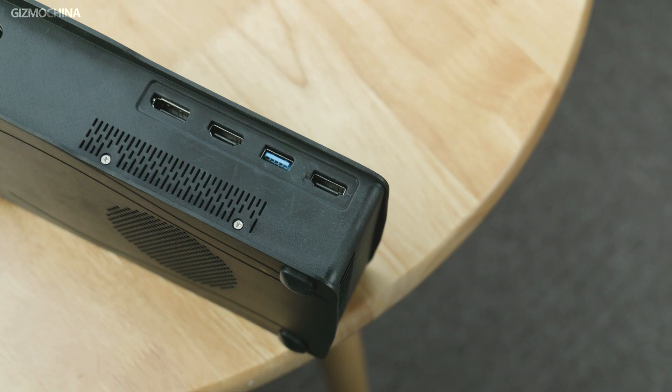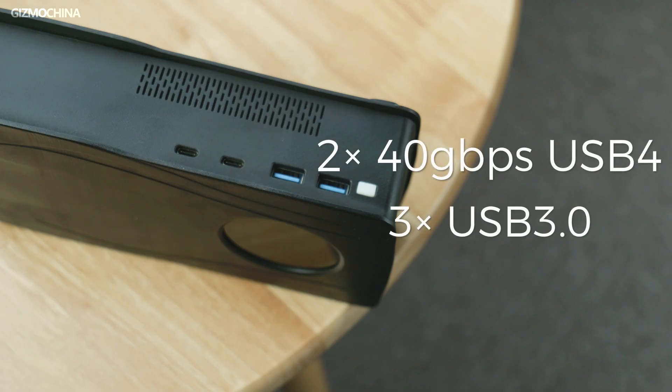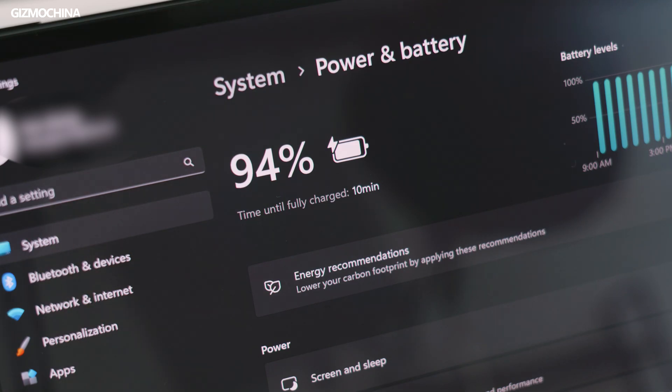What's interesting is that you can also showcase your own pictures or videos on the round screen as a geek deco. Compared with some regular eGPU products, the graphics box offers a lot more ports. There are two HDMI 2.0 and a DP 1.4 for video output, and there are also two 40 Gbps Thunderbolt-compatible USB 4 ports. In addition, you can even find three USB 3.0 ports, so this eGPU can even act as a docking station in addition to providing additional graphics performance.